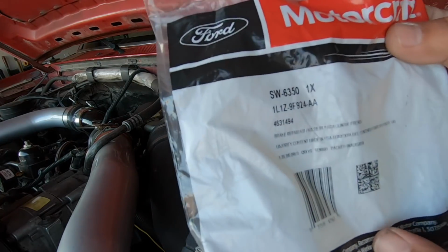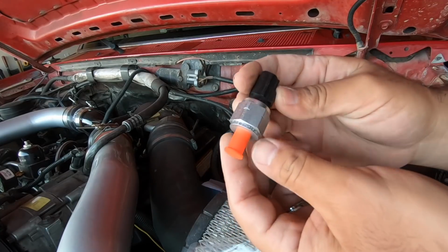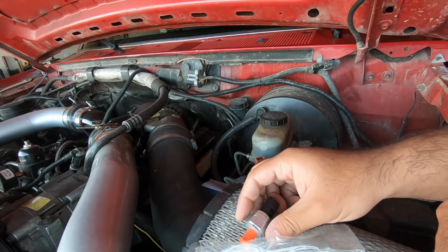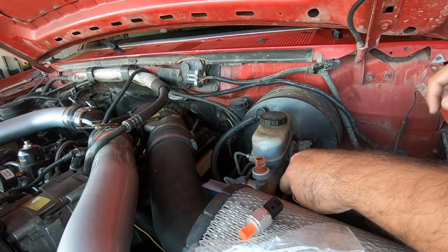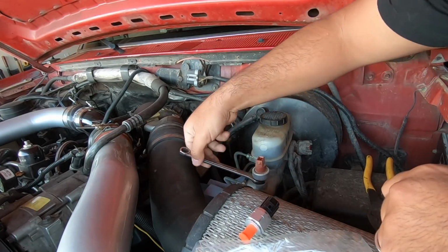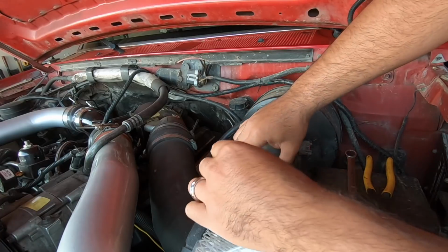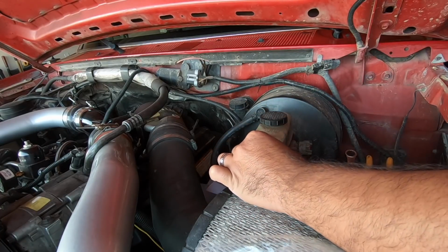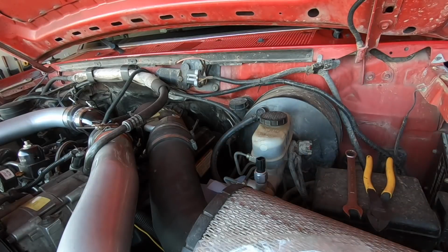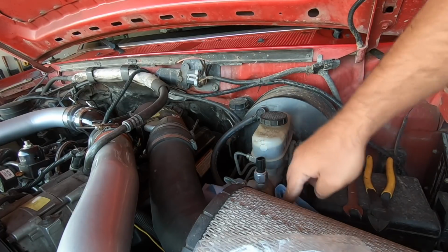We're gonna go ahead and open up the new one. I'll show you the part number again, and I'll leave a link to it down in the description and in the comments for you guys to check out. So here is the actual switch. Nothing fancy, nothing special. Like I said, there shouldn't be that much to it. So we're gonna take our 9/16, take the old one out. I'm gonna get this one ready. And there is that. We only lost a couple drops of brake fluid.